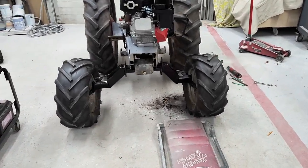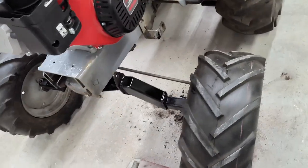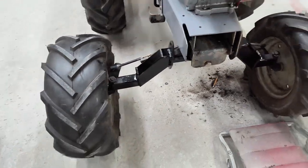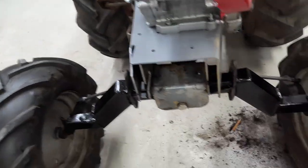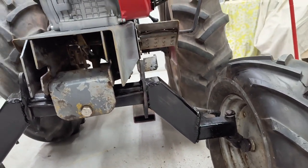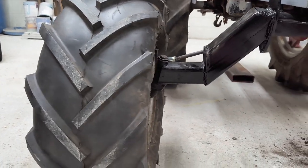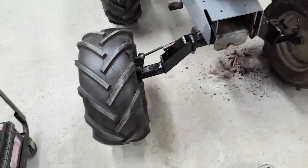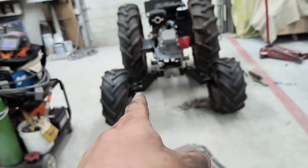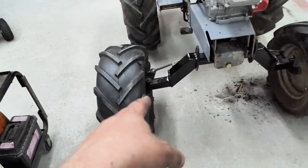It's weird — when you get right up on top of it that tire looks like it's shooting out so far. The tie rod ends: I had to extend one so that one's fine, but the other I was in a rush and boogered it together. I tested it a little bit — yes, I know, dangerous — but nothing has cracked, nothing has subsided, no paint chips yet. I just need to get that one wheel moved in more because it is bad. I'm going to have to cut that one down and move it in — maybe measure both and see what's off, because one might actually be bent.